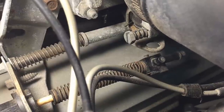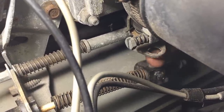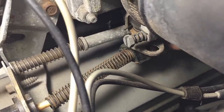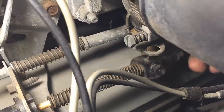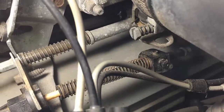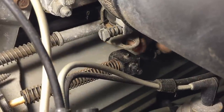On the Ford Mustang, it's underneath the throttle body. Here's the throttle cable right here, and over here is another hole — see that? Well, this TV cable should be stuck up in there, so when you hit the throttle, this one moves also. Right now it's just dangling there, and the pressure is not being adjusted based on throttle input — that's where you can burn up your overdrive band.